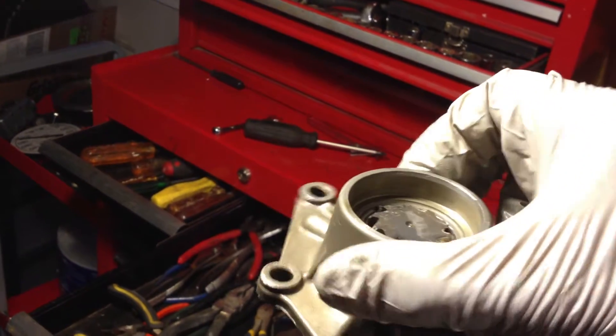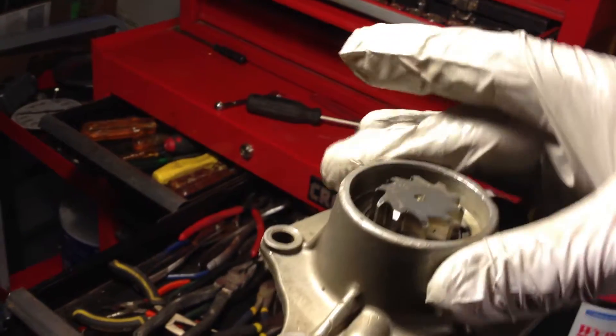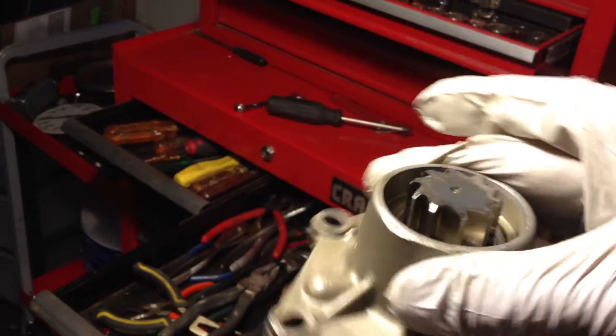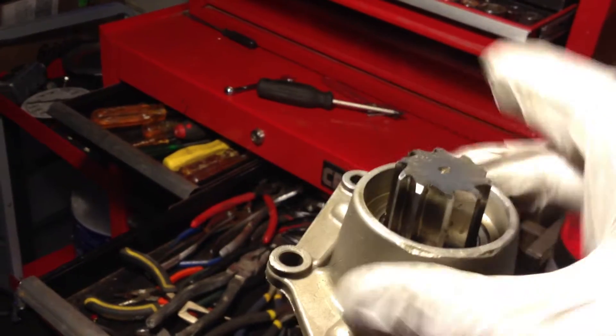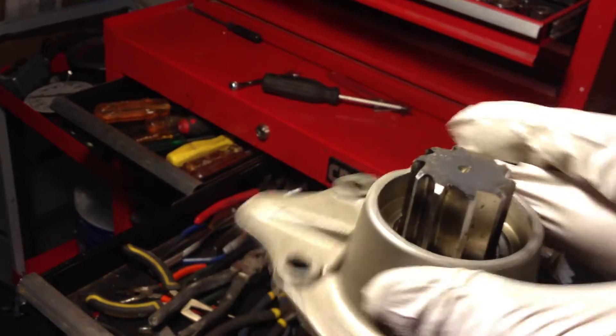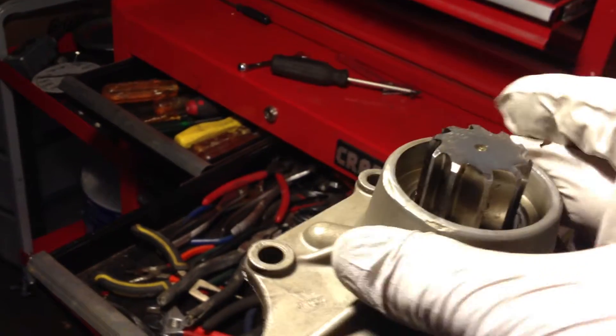This is the finished one, just to show you — it's taking a little bit of time as you go down further. Get to the 1.250, it's a little tighter, and you want to turn it, and as you turn it you go down onto the reamer — you'll make some squeaks. You don't want it to chatter, so as you turn it you want to move it up and down on the reamer. Now I'm lifting it back up and it's getting looser.